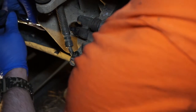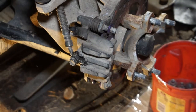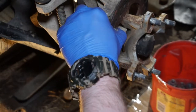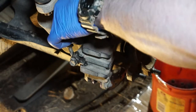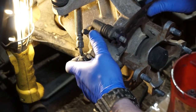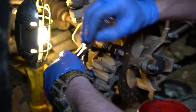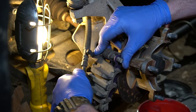We're just doing a complete swap. Take out your bottom bolt — 12 millimeter. I always keep a bucket so I don't lose anything; ain't nothing worse than losing bolts and not being able to finish. Take out your top one as well. Once you have those two bolts out, the caliper should just come right off like that.